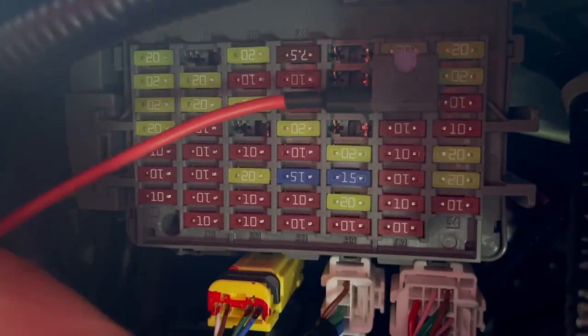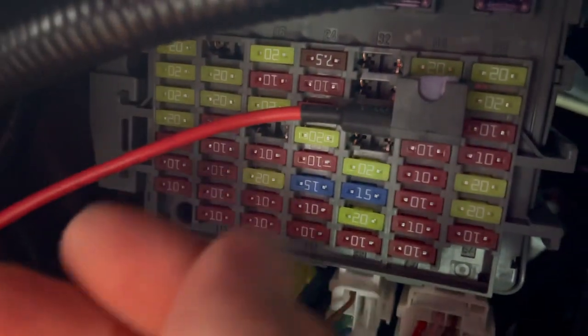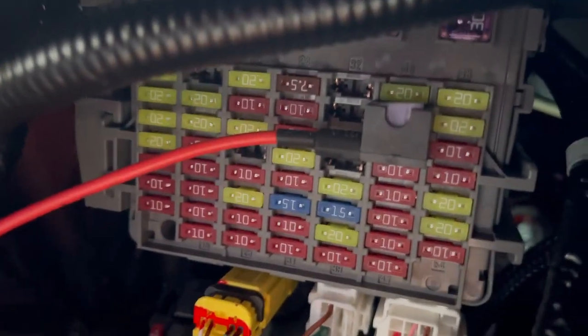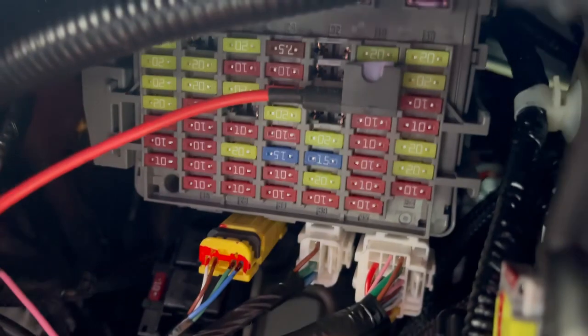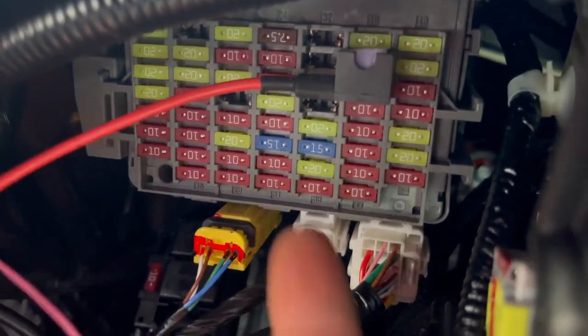For example, there we go. Obviously, when you buy a brand new Airlift harness, it will come with this cable. If you don't have it, I will try to get you a link and put it in the description, but this cable is very important. It makes everything neater and cleaner. What I'm trying to say is, it's much safer than just putting a wire somewhere, tapping it into something else. This has a fuse that, if something goes wrong, will blow before it messes up anything more important. So this is the way to go.